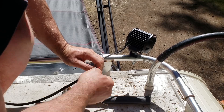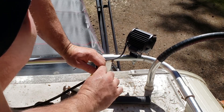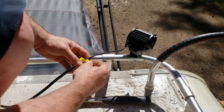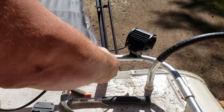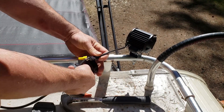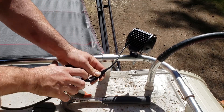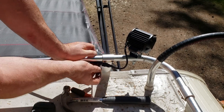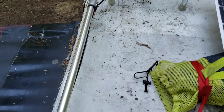Normally you'd want to use butt connectors and shrink wrap tubing to make sure connections are nice and watertight, but out on the road I ran out, so I used twist connectors and taped everything together — I'll probably come back and do it properly with butt connectors. Sometimes you just have to use what you have. It's been six months and it's still working great. You can use whatever you wish to attach these wires. Then I used wire ties to secure the wiring to the luggage rack and worked my way around to all the lights.